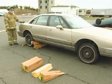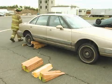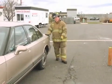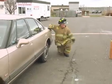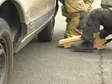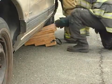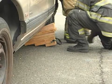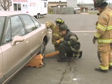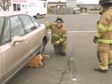Let's walk around on the driver's side and we'll stabilize that side of the vehicle. Now what we're going to do is stabilize the rear driver's side of the vehicle. Firefighters are going to come in with their step chocks and their wedges. We stabilize the vehicle, and then again, we want to use a four-by-four behind the rear tire just to prevent this vehicle from rolling when we do perform our lift.